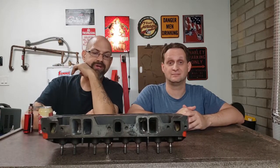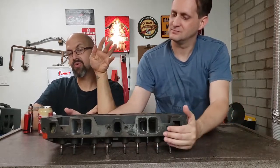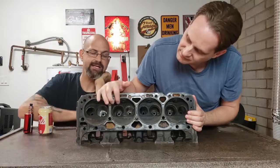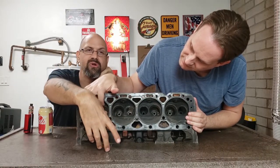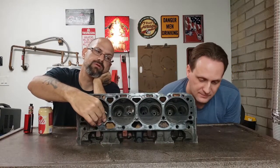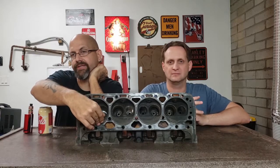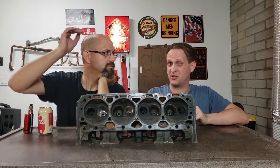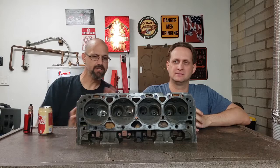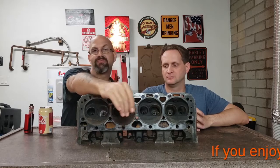So, when you guys are doing this job, I did everything correct last week. Don't take me wrong. You guys can still follow everything I did. Just when you get up to your valve seats themselves, do not touch them. You stop just underneath them. Do not get into them. You can get close, but don't touch them. If you nick them or anything, you're screwed. Everything else I did perfectly, just stay away from your valve seats.